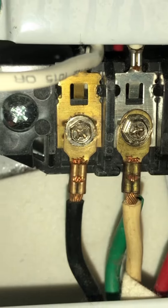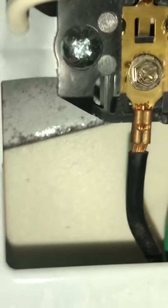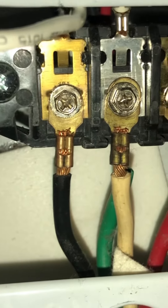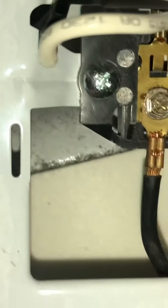If you have a four-wire hookup — so if your home was built after 1996 — you should have a black cord and a four-wire hookup. This is very important: if you had a short, meaning a wire touching the body of the machine, and you touch the machine, you would become energized as well.